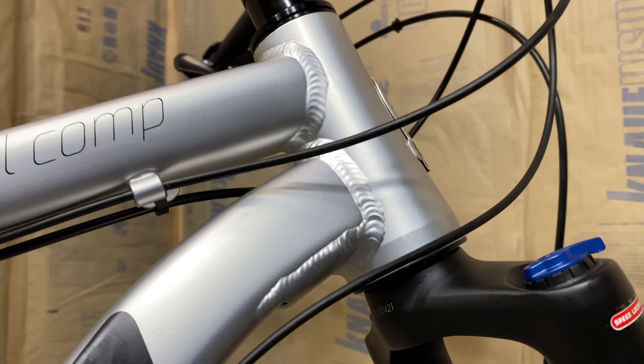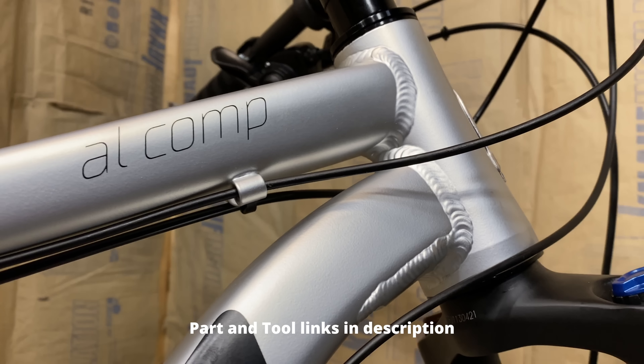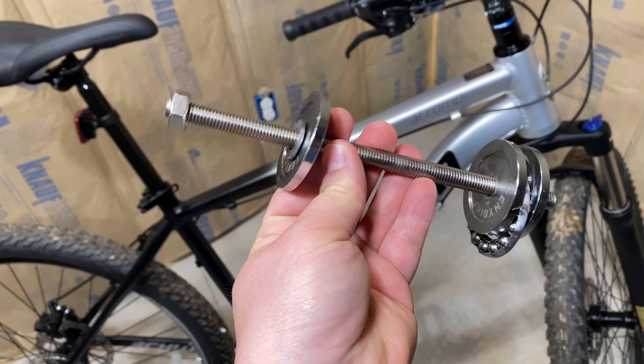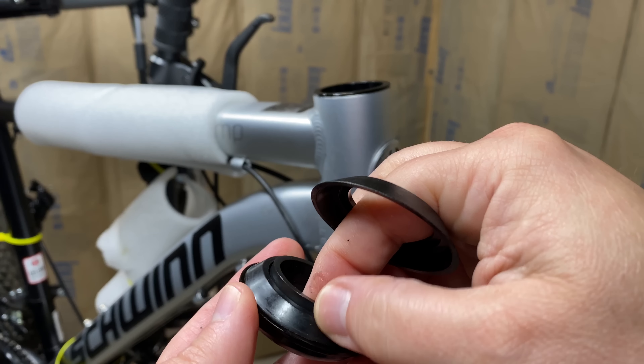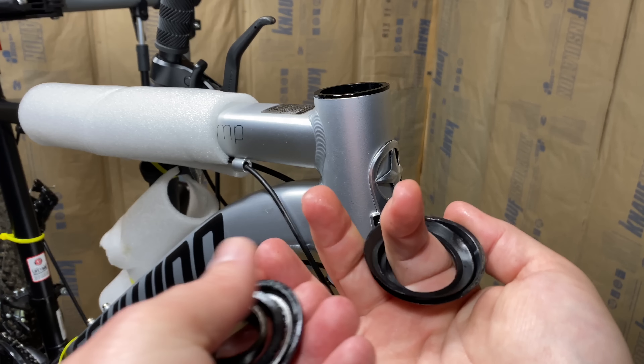New fork, new headset. Questions answered: are these legit tapered head tubes? Yes — and that goes for the new Aluminum Comp, the Boundary, the TAF, and the new Schwinn Axum. Parts required: a ZS5640 lower headset, and those headsets are as cheap as under $25. Link down in the description, along with one for the two new tools. I really like the headset cup removal tool. That cheap press, though — I'm not a fan; it's definitely not on my favorites list. For the same cost, the local bike shop used the proper tool. And really, for the average rider, how often does someone press in a lower headset cup?